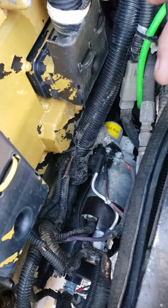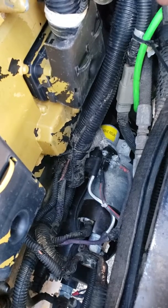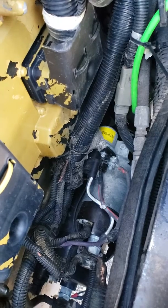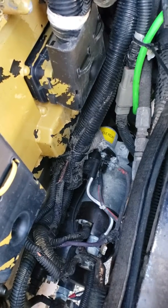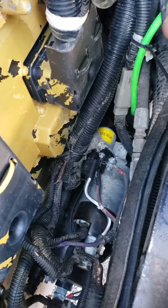And basically just some ways to double check what your findings are. In which case I found my wire, double checked it by pulling off the hot side of the gauge, plugged it back in, checked it again, and that verified that was the correct wire. Now I can replace the wire and be on my way.